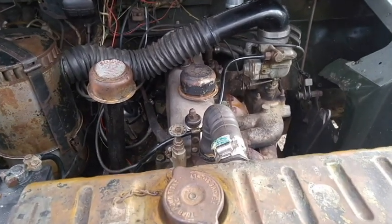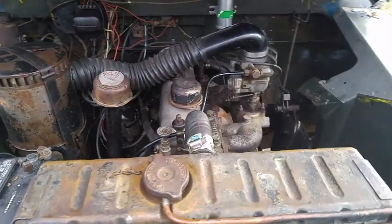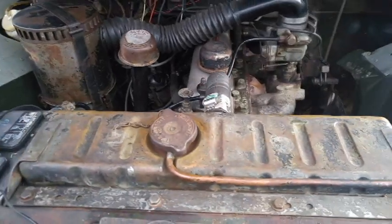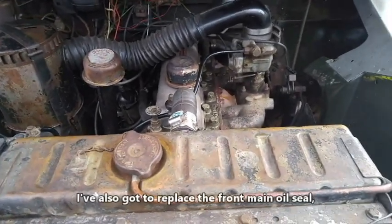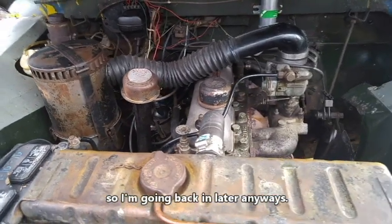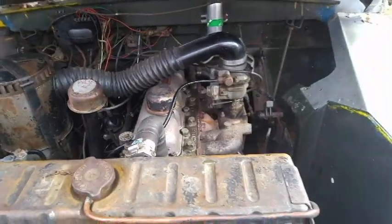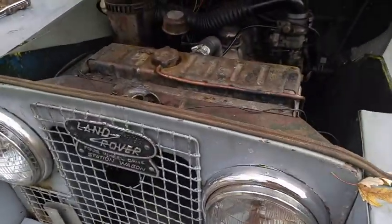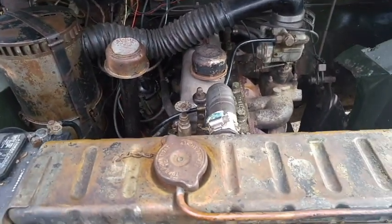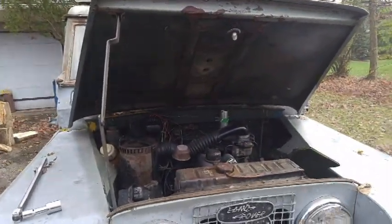What I'm not sure about is what I'm going to do. I might either take the current chain off and replace it with the chain from my spare engine, which has quite a few fewer miles on it. Or, what I'd prefer to do is reuse the chain that's still in the engine, because it's still got life left in it, and just adjust the timing using the offset splines on the cam chain wheel to get it back in time. I'm going to have to take off the front cover, so I need to drain the cooling system, and while I'm doing that, since it's almost winter, I'm going to swap over to the 82-degree thermostat.